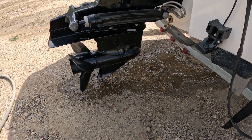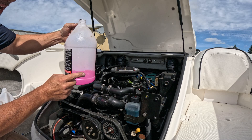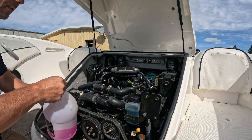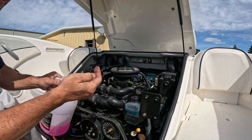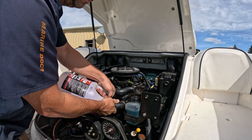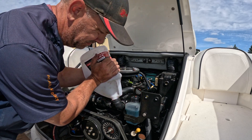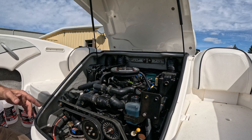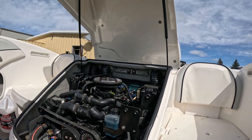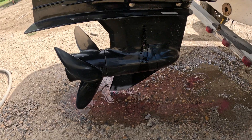What we're going to do is pour the antifreeze in from the top until antifreeze comes out those holes. We'll jump back into the boat and I'll show you guys how we do that. Remember we need the small amount that's still in the bottle. We're going to push this inside, tilt it up, and push. When we jump back out of the boat we're going to see that there's antifreeze coming out of the water intakes. And there it is — plenty of pink coming out, so we know that it's been flushed.